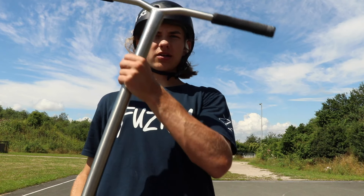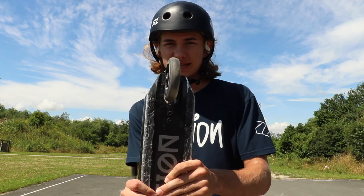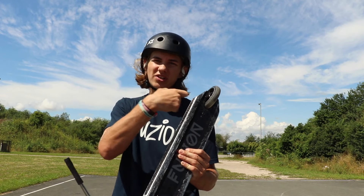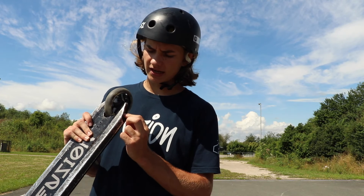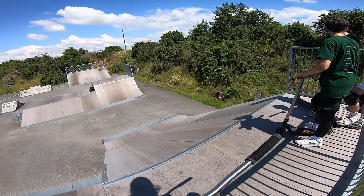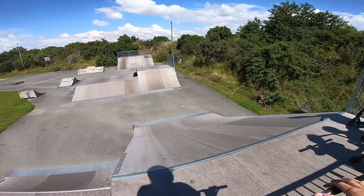The reason for this is that when you grind, the deck tends to bend up — no matter how good your deck is. This excludes boxed ends, which is a different story. For decks shaped like this, if you do grinds, the deck will eventually bend up. It's a thin piece of metal and it will always bend. When that happens you may not be able to get your socket in there anymore. A great tip is to put the allen key side on the side you dominantly grind on, because once the deck bends up you can still slide your skinnier allen key in there and put your socket on the other side.